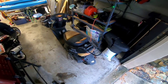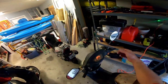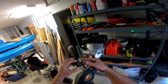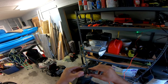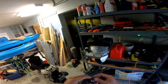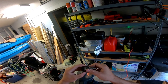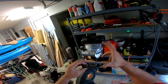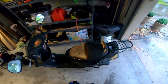Your scooter is now warmed up and ready to go. I can hear that Bendix clutch though - sounds a little rough, might be time to replace it. For those wondering what a Bendix clutch is, it's a starter clutch gear. When you activate the starter switch it throws this gear out, making contact with the starter gear and turning the engine over. When you let off the starter it relieves pressure and retracts. That's how it starts.